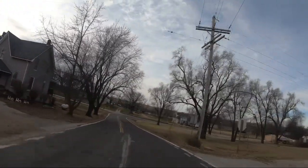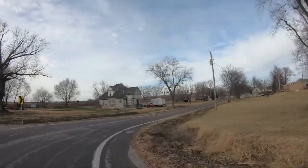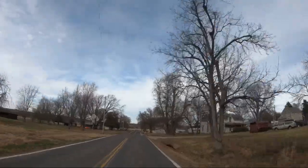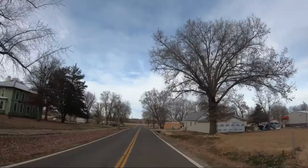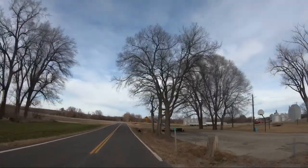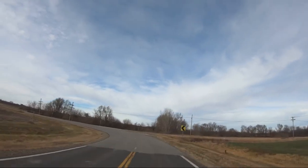So another good tip is, if you're going to ride your bike to the gas station, it's better to get it warmed up to running temperature in the wintertime. Let it idle in your garage or your carport. I have a carport, so I let it run in the carport for a few minutes before I even get on it and move it. In the wintertime especially, it should get up to operating temperature, probably 200 some degrees in the motor, before you shut it off.